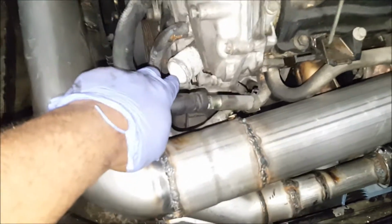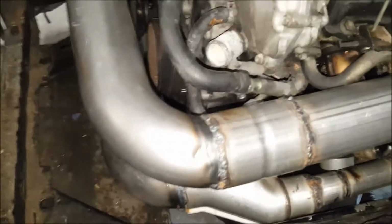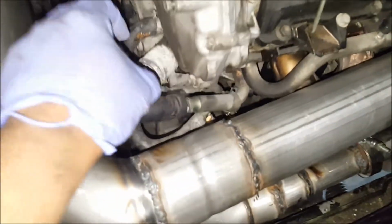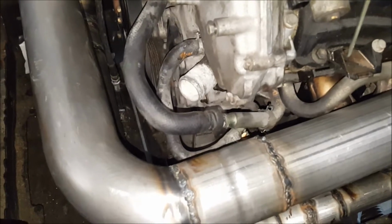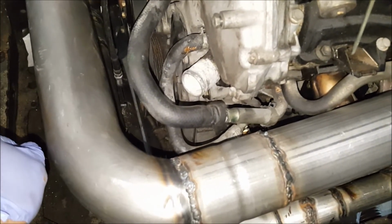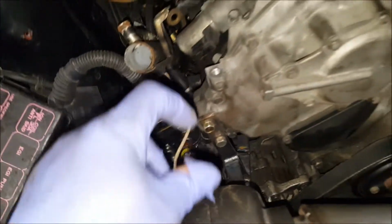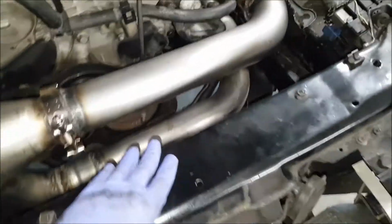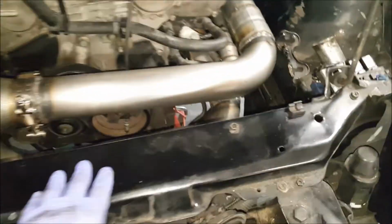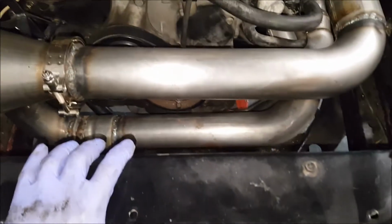On this one here, I'll just put a 45 on there. I mean, weld it, since I can weld now, weld a 45 to come out, or actually it just needs to go down, because this is the feed into the motor, which will come from the bottom of the transmission. So the bottom of the tranny, and then the top goes right there. I'll mount it right here, then come across, and I'm going to go with the Honda Civic radiator, a 3-row radiator.